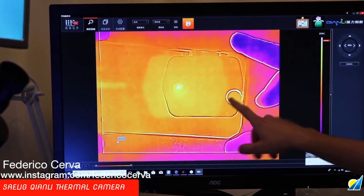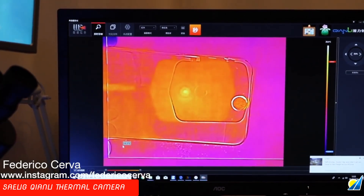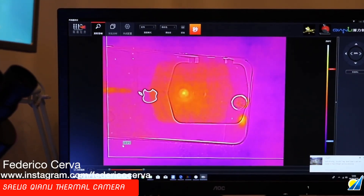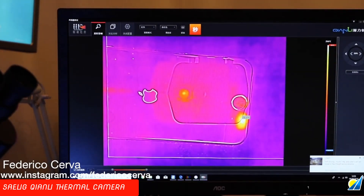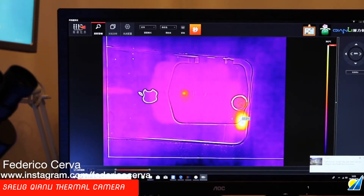So here we have the home button. We're going to boot the phone. As you can see, it's turning on. Now let's have a look and see what gets hot. There we go. As you can see here, the actual chip by the button is getting hot. If you hover your cursor over it, it will tell you the exact degrees.